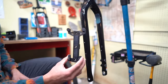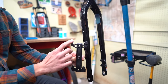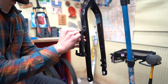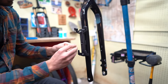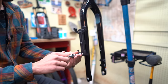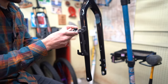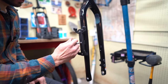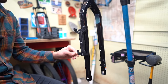Let's get started with installing it on a carbon fork that has three eyelets. First, just ensure you have the proper orientation — it should be installed upward like this, so these little circles should be faced upward and out. Put in the first two — the bottom one and the top one — and just hand tighten. Then throw in the middle one; it's a 3mm. Just make sure they are tight — they say one newton meter — and then every so often, just make sure that the screws are not loose on the plate.